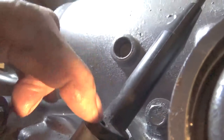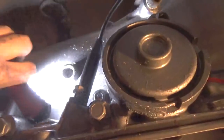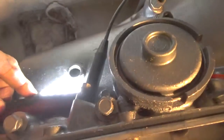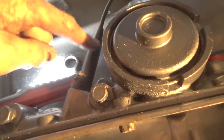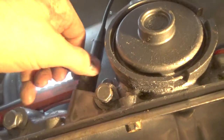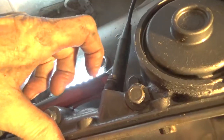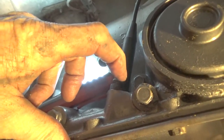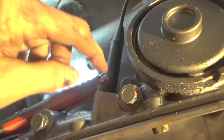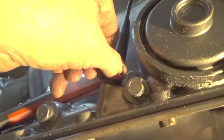And then there's a bolt that goes in here yet, so we have to get that bolt. Okay, so this little bolt here I'm putting in, man, is it hard to hold all this stuff. Alright, so there's a bolt here that goes into this cable that comes down from the throttle body. Now once that linkage is hooked together, you put this in here and it compresses the rubber sleeve that's inside the metal. So in other words, where that linkage was, the big round hole that the linkage was coming out of, you have to put a seal in there first that this piece of plastic fits into, and that seals against the sides of the transmission. So once you put that in there, then you can put it together and set it down in.